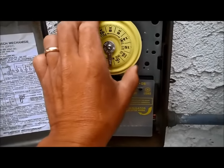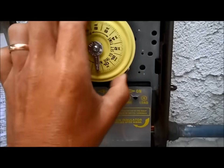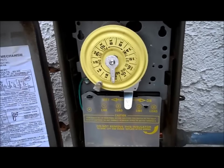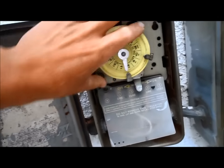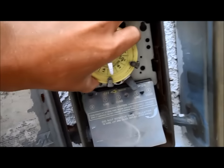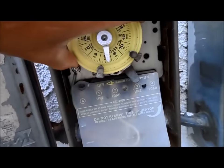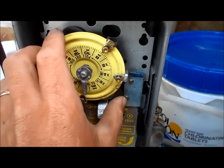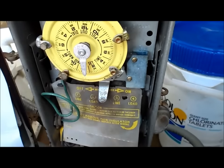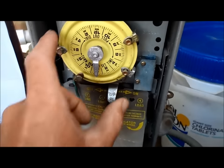You can actually hand-turn this thing. Sometimes if it's not activating, it may not be in its slot, so you've got to make sure that you hear that click — it's got to be in the slot, or it won't operate. If the timer is right next to the on/off tripper, you won't be able to turn it on and off, so you simply pick it up and move it. This is also how you set the time — by pulling up on the dial and turning the face, then make sure it clicks back in when you're done. So you can adjust the timer if you lose power or if you need to change the time. It's very simple.